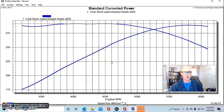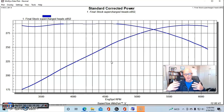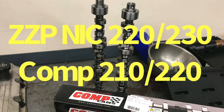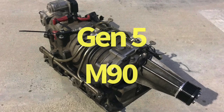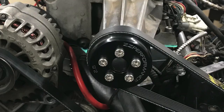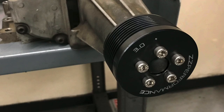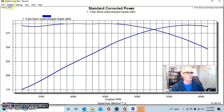Here's where we eventually took this combination. I have a set of ported heads with a valve spring upgrade, fresh valve job, resurfaced and ready to go. I also have a ZZP NIC cam we used, and a gen 5 supercharger with a ZZP hub and pulley setup — a 3.0, a 3.8, and a 2.6 pulley. The snout has already been machined to accept the 2.6 pulley.